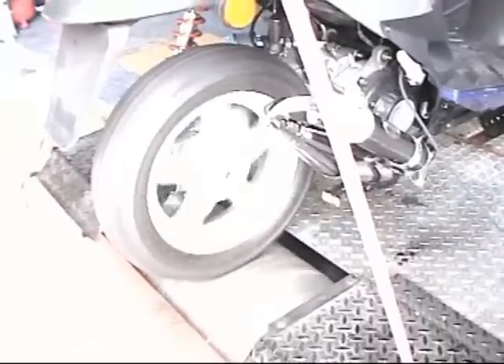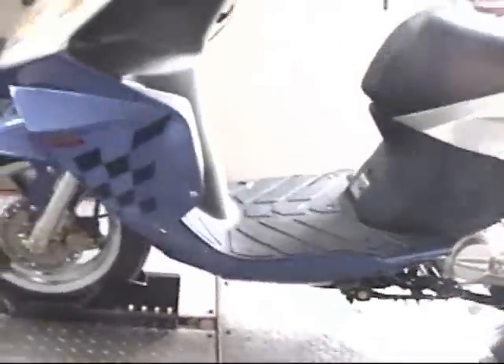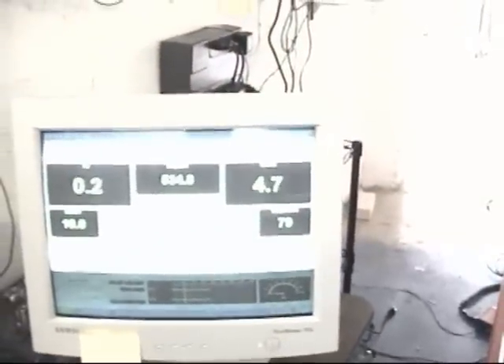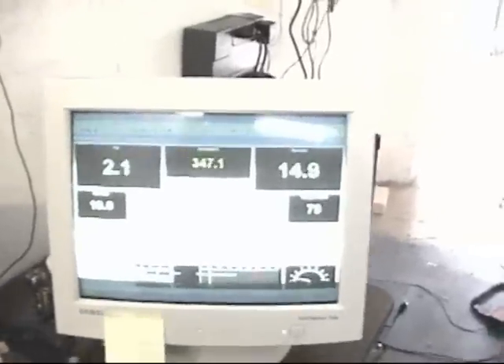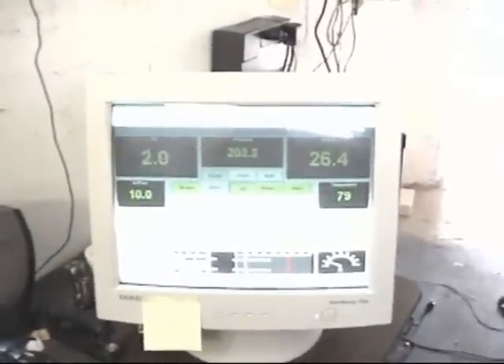This is our in-house Land and Sea dyno here at MRP. You've seen it in some of the other videos while we work on the bikes. We put the E5 S5 here to work on the dyno. This is an S5, but both of them are basically the same scooter, just different panels. So let's take a look at how it performs and how fast we can accelerate it to the 41-mile-per-hour range that we're looking for. So without the 70cc kit — I'm going to put the dyno test with the 70cc kit afterwards — let's see how it does.